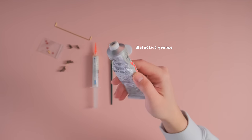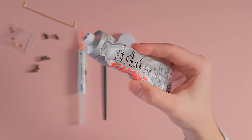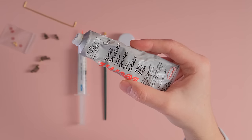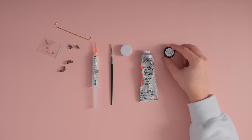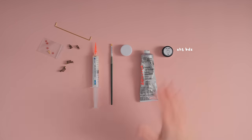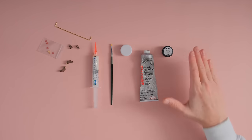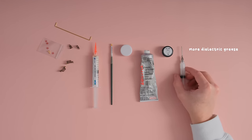The caps on these dielectric grease containers just keep breaking — Loctite and whatever other companies are making these, every cap breaks. Please find better caps. The dielectric grease will strictly just be for the wire, where the metal meets the plastic. Alternatively, you could use some XHT-BDZ. This applies thicker and you don't need as much compared to dielectric grease. It's also supposedly supposed to last longer, though I can't confirm that. As another option, I do have a syringe of dielectric grease.